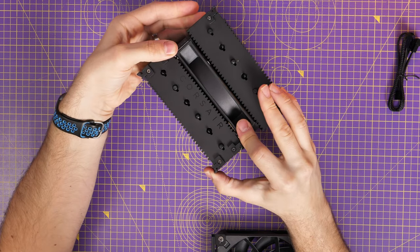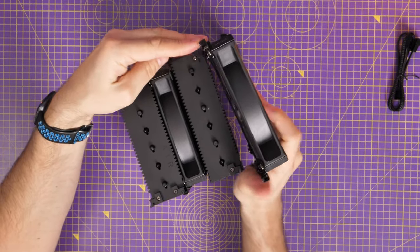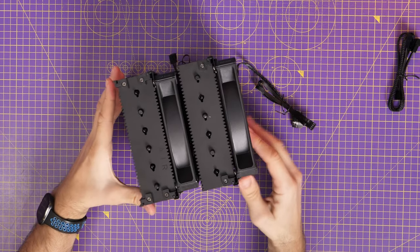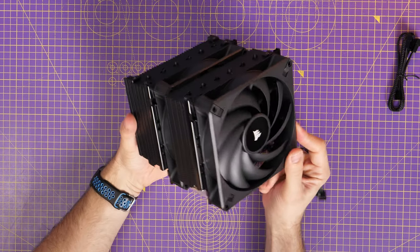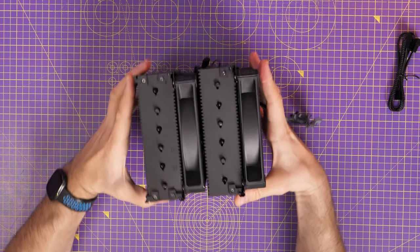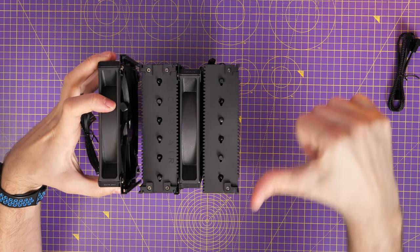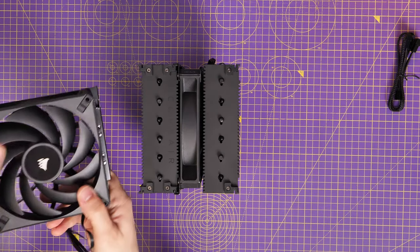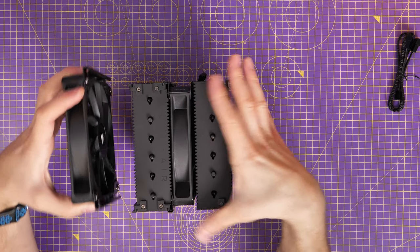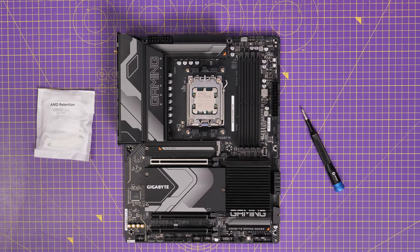You probably don't want to replace the fans just yet because you need to access the screws to secure the cooler to the motherboard — you need to remove the middle fan for that. You can seat the outer fan on and use that to test-fit and check RAM clearance. Note that you can't take a fan off one side and just put it on the other side because the bracketing will be wrong and the fans will end up facing different directions, fighting each other. We want air to come through from the front, pass through, and come out the back.